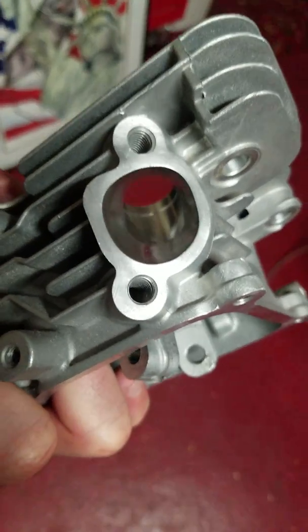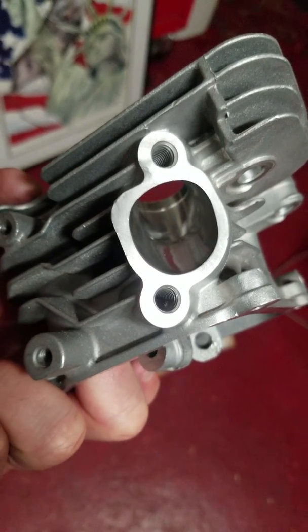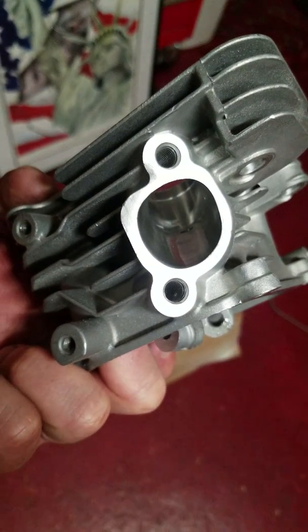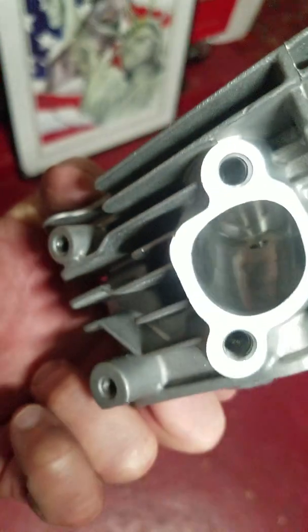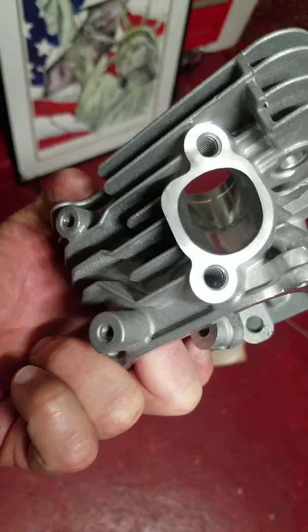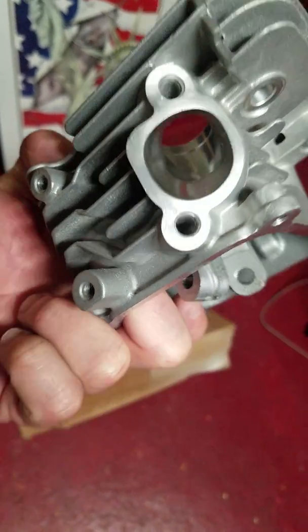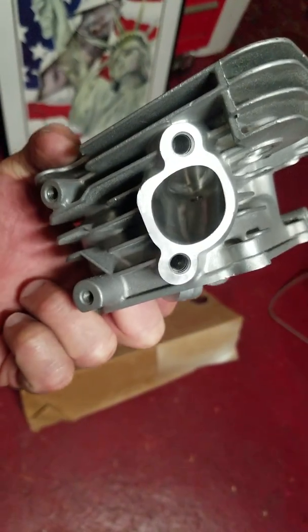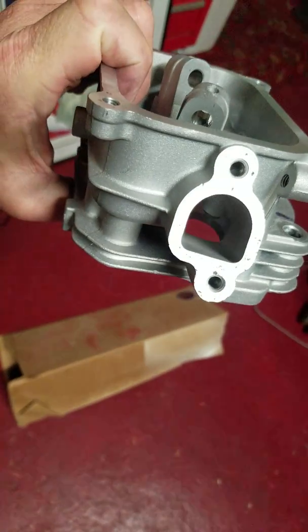That's the difference now. I cleaned up the old exhaust gasket. It's not too thin. It's pretty even all the way around. There's a little light spot right on that corner. It's a little bit light, but again, the exhaust gasket should seal that up pretty good. So I'm fairly happy with the way the exhaust port and polish came out. Next will be the intake side.